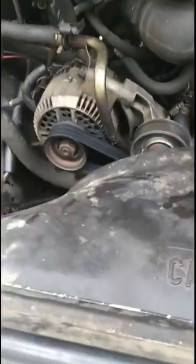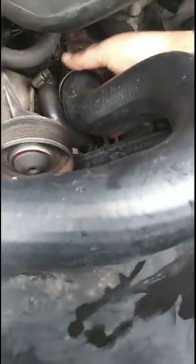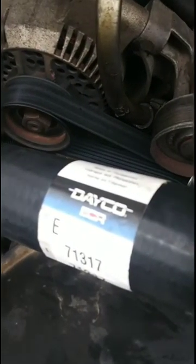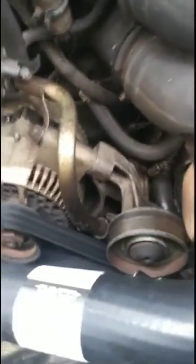So the first thing I want to do, I don't want to worry about these clamps just yet. I want to get the hose on and make sure it's not going to be twisted or kinked in any way. So let's try that. So this one is going to go on just like that, and see if we can wiggle this clamp back down in here a little bit. Alright, and you want to leave a little bit of space. You don't want it to be too far down because it'll slide off the edge of the hose, and that could cause a problem.